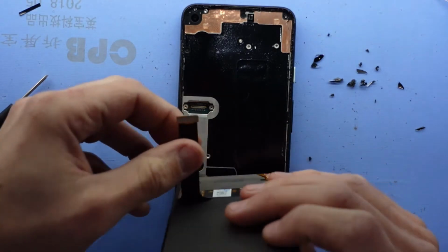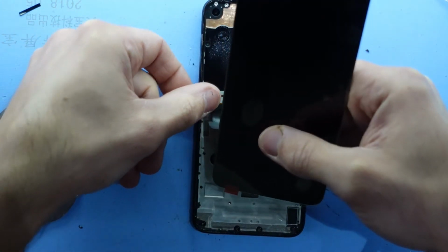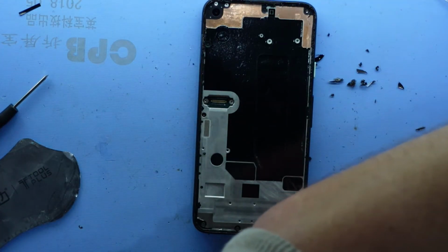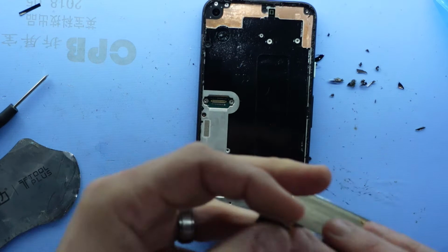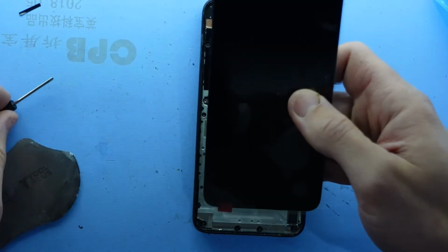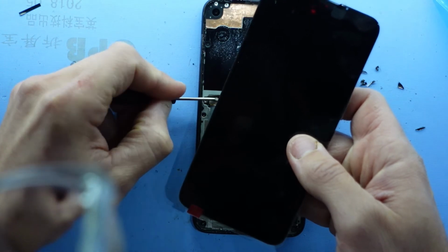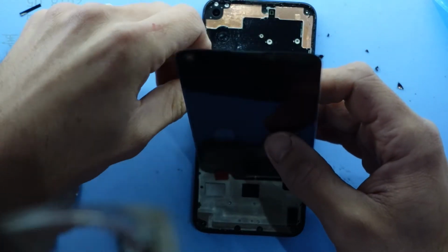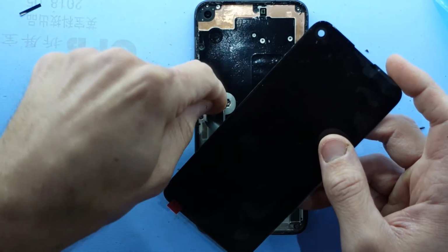Next up, we want to reconnect it. Now this may be a little bit hard for me to capture on film for you guys. I am just having a look at the original connector, which, if it stops wobbling, you can see has a slight kink to it. So I do want to emulate that kind of kink. Go like that to begin with. And I'll use the flathead screwdriver to try and click it on. I'm pretty happy with that. Can't quite see it from your angle, but that did make a little bit of a crunch click when I connected it.